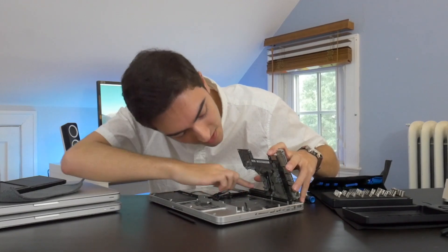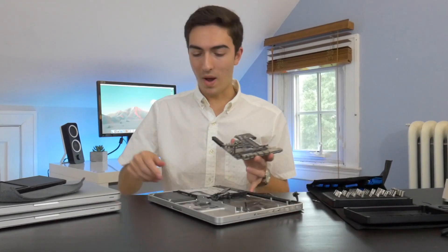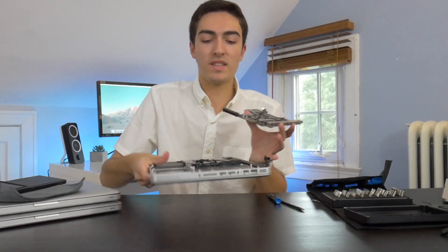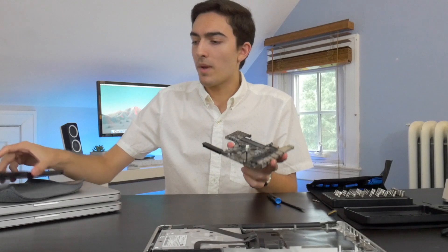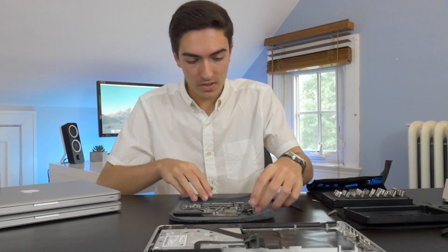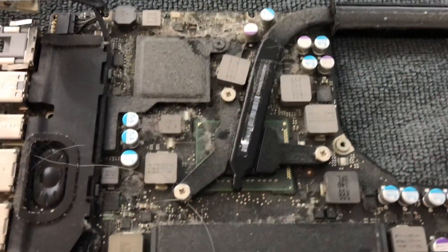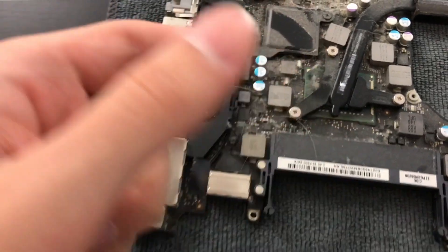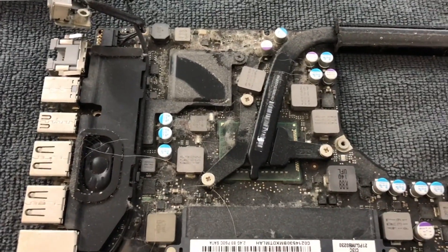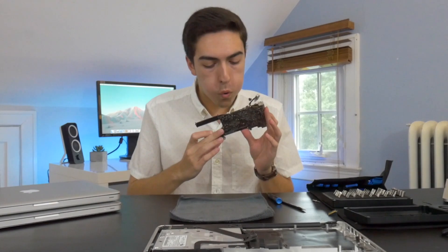The sticker on the heat sink was actually stuck to the top of the keyboard cover. This is one dirty, dirty motherboard on the underside — no wonder this thing is having trouble getting cooled. I can imagine the thermal paste under there is garbage, and look at how dusty it is. Our old friend the compressed air comes back. It's really incredible how dusty these things get.